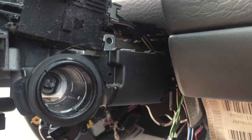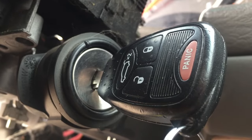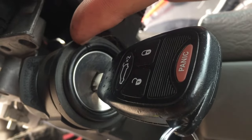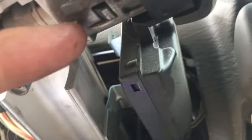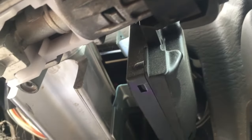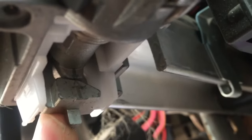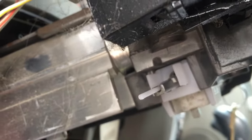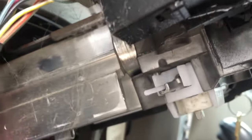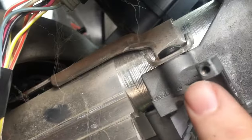There's just a little bit of alignment to deal with and get correct. That wasn't too terribly difficult. You see there's the mark for the neutral position of your key, so this is roughly the on position — slid right in. See that tab — it's back in here. That's what I need to press if I want to release the key, and those alignment marks are still in place. Now I need to get my ignition switch with its indexing correct as well, turn it to the on position, and slide it back onto this little metal piece. Once that's in place, I'll be able to screw it in.